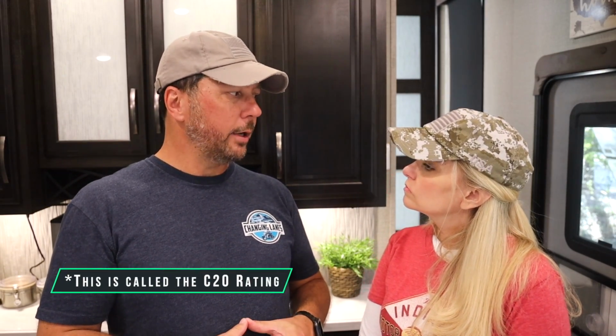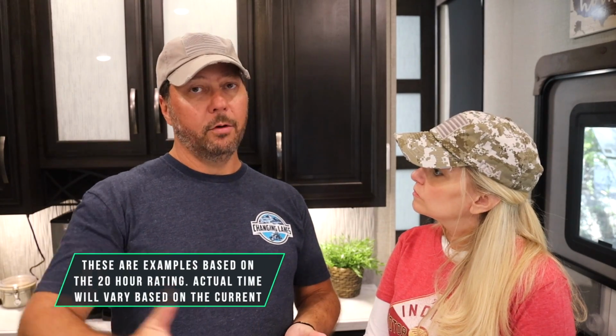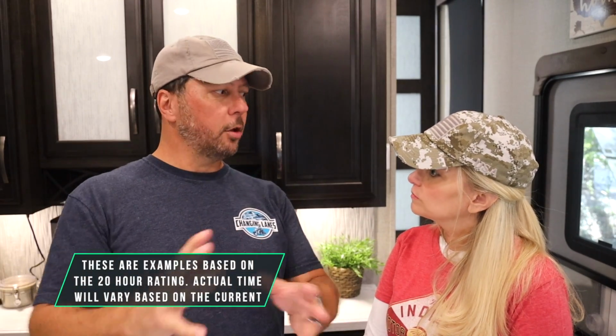Amp hours is a rating of how much power over how much time you can supply. Let's take a good example, it's easy math, of a 100 amp hour battery. A 100 amp hour battery is rated that way at 20 hours, meaning it's been tested that it can supply 5 amps of power for 20 hours. That's 100 amp hours, 5 times 20. It could also do 1 amp for 100 hours, or 100 amps for 1 hour, or 200 amps for half an hour. Gotcha. So it's all just a math thing.